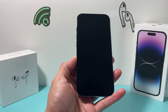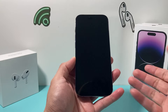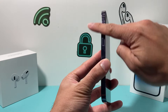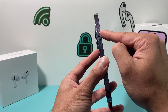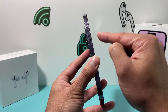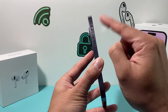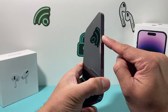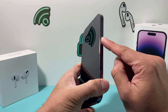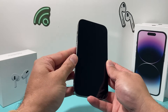The very first thing to try if you're having this issue is doing a forced restart on your iPhone. It's an important instruction — a couple sequence of buttons that you have to follow. First, press and release the volume up, followed by press and release the volume down, one after another. Finally, hold the side button on your right hand side until you see the Apple logo appear. You may have to hold it about five, sometimes up to ten seconds for it to turn on.